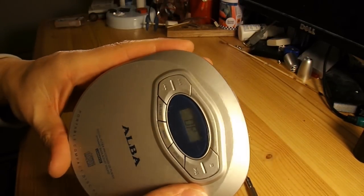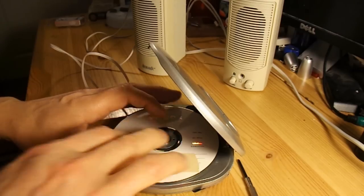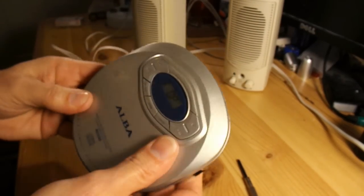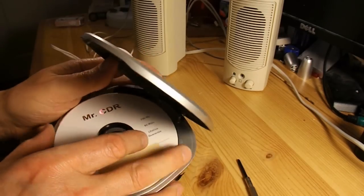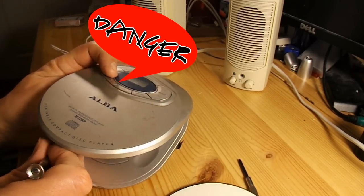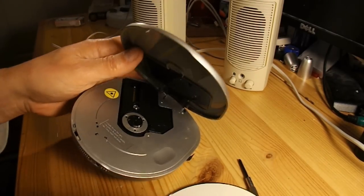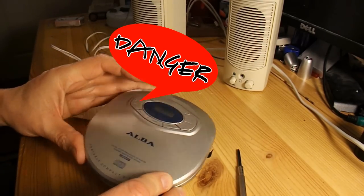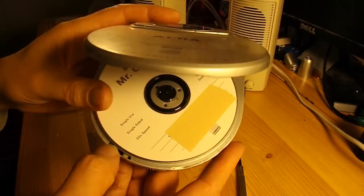The display's working. I'd better find a CD and some speakers. Got some speakers. Got a CD with some music on it. Right, that's not detecting that I've shut the lid. So we've lost the little pillar — that's the other problem. We've got nothing to tell it the lid's down. Didn't notice that. Still says open. So the only way round that would be to override it and poke something in there.